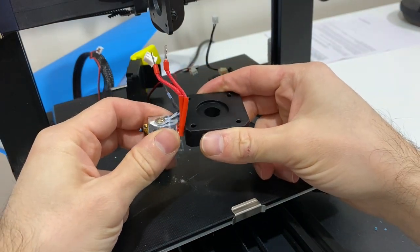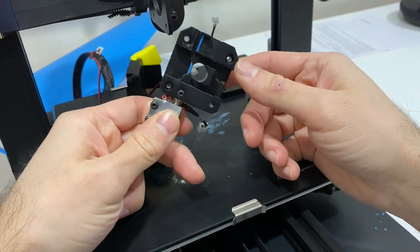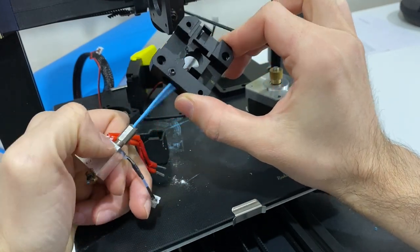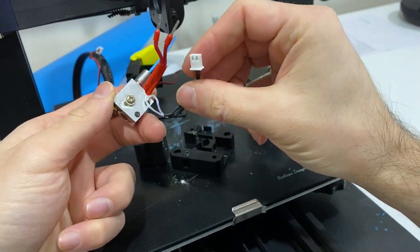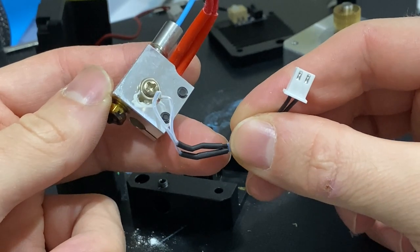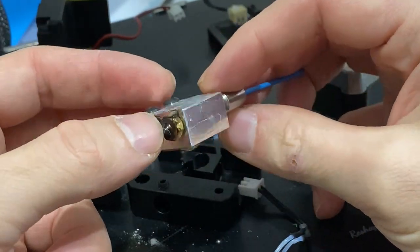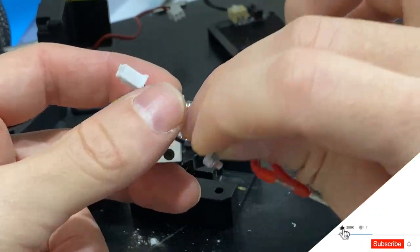I'm going to remove the silicone cover, which is easily removed — this is my heater block. I'm not sure exactly what happened with my thermistor: either the thermistor went bad or it's the thermistor connection at the circuit. But I'm more focused on the circuit because my socket connections are bad. Just in case, I'm also replacing the heater block. When you release this set screw it releases the extruder. As you can see, this is the heater block — thermistor connection comes from here. You might be able to see the white thermal paste. If you unscrew these two holes you can detach the heater block too, and the nozzle is in here. You can see my entire filament melted around it.